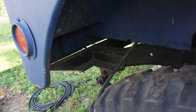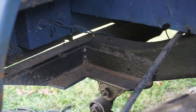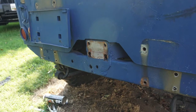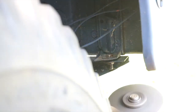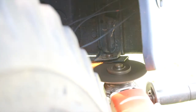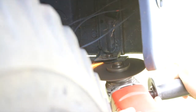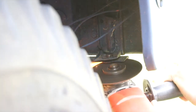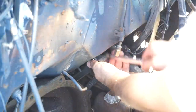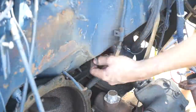It's a nice piece of angle iron helping support the rear crossmember — I don't know why it's really there, kind of unnecessary. There's some rot on that part of the frame — I forgot, I didn't take a photo of that. That was a bolt that was just so frozen it was not coming off, so I decided to just use a cut disc on it — not the easiest way, but easier than trying to unscrew a really bad bolt. I'm just detaching the whole body right now, removing parts, removing the clutch and brake pedals so I can remove the tub without it getting hung up on those.